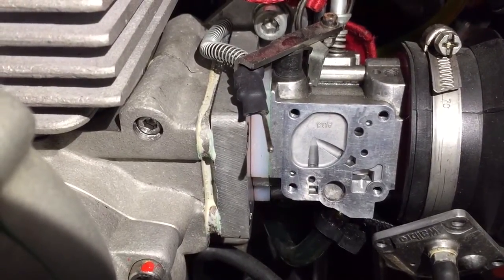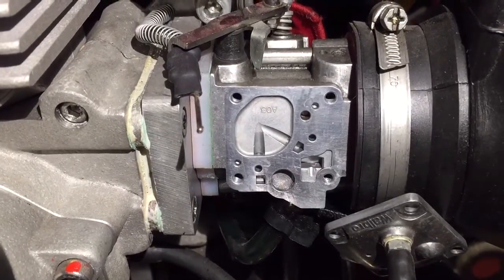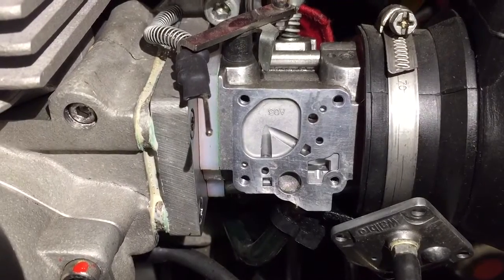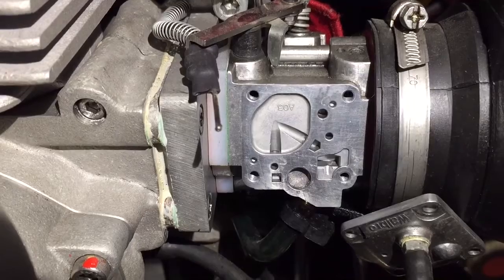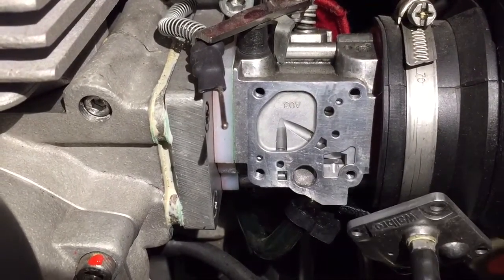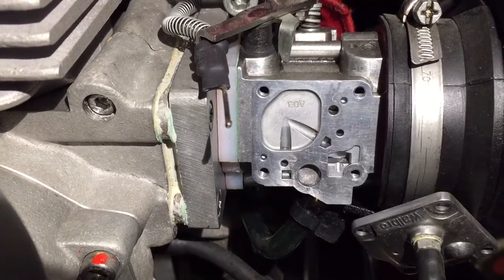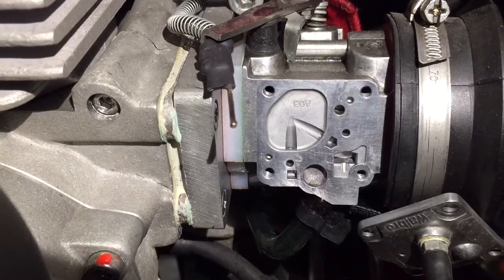In addition to cleaning this little gauze out every six months, what you can do is purchase a Mr. Funnel and filter all your fuel. I've found that since using Mr. Funnel I only have to clean my filters maybe once every two years — this is the first time I'm cleaning mine in most likely that time frame. With Mr. Funnel it keeps all your fuel totally clean and the tank clean.